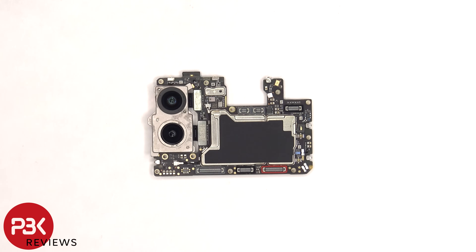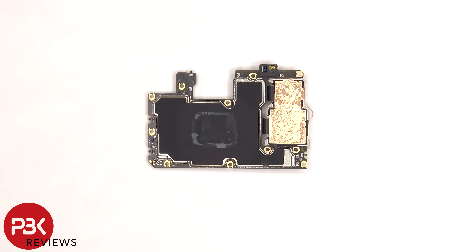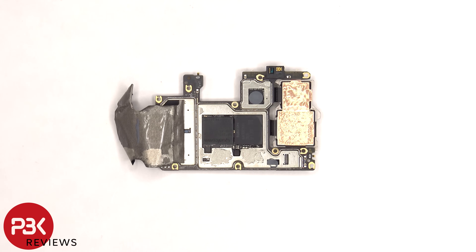The camera connectors can be disconnected by just popping them off. There's another microphone on the top corner, a liquid damage indicator sticker — that white sticker — rubber gaskets around the connectors, and some graphite film over the front shields. The proximity sensor is located on the back, and there's some copper tape behind the cameras. There's also graphite film on the back shields as well as thermal paste. Once the graphite film is peeled back, we can see more thermal paste on this chip, the RAM, and a thermal pad on the processor.